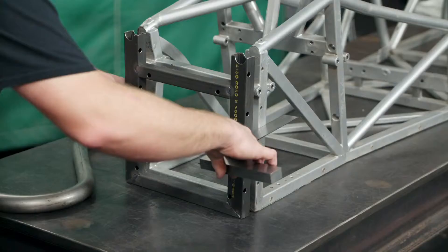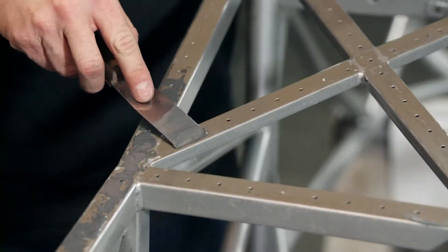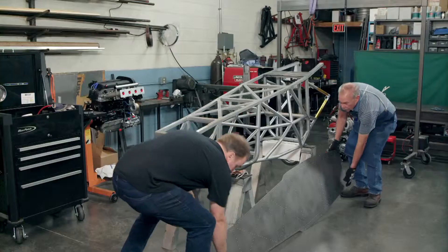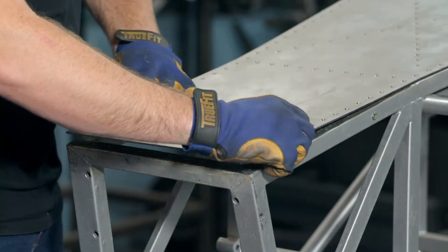He compares the newly fabricated bulkhead to the standard. Once the frame is complete, the technician applies epoxy to the base in preparation for floor installation. Since the steel floor is substantial in thickness and weight, it takes two technicians to lift it onto the epoxied section of the space frame.